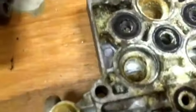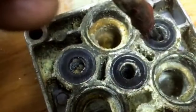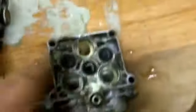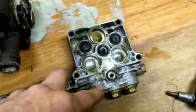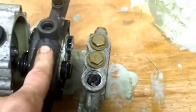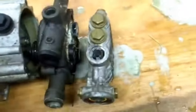You can look and see the inlet and outlet non-return valves and clean them all out. They're not always easy to get out, but all they are is spring-loaded buttons. If there's any muck in them you can actually see it. You're not going to get a perfect job, but you can get some of the muck out and at least get yourself going again. Most good manufacturers will sell you those valves and also pump washers. There's no timing and no particular drama in taking this front section off.